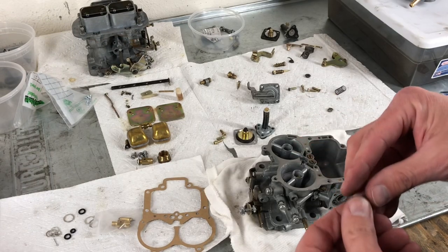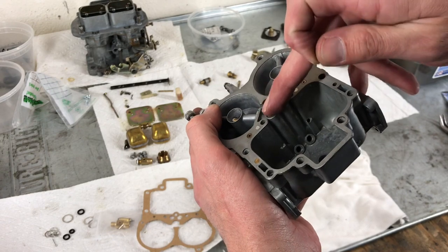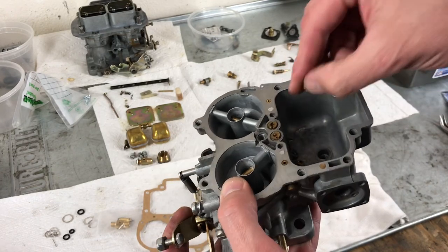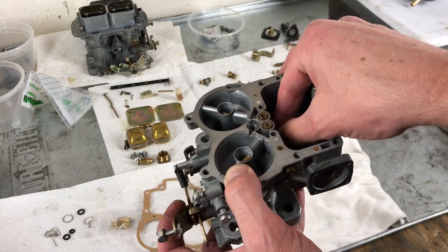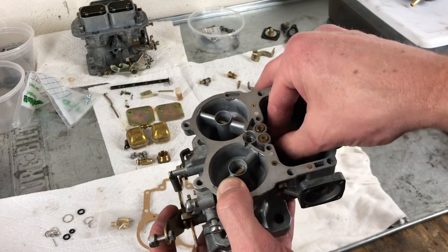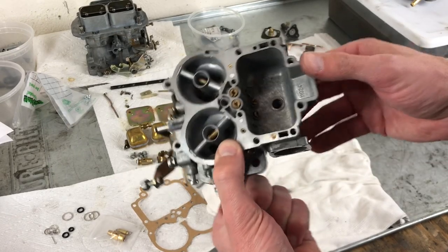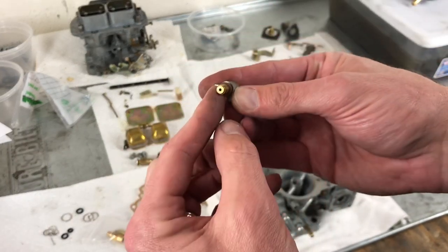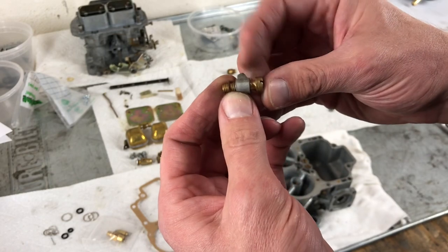Now that the air jets are in place, we're going to move on to the main jets, which are going to be down in the fuel bowl. The left side is going to be the 145, and the secondary will receive the 135. Your jet sizes might be different if you're building for a different vehicle or engine — these are what are running on the 240Z. With the main jets in place, we're going to place the accelerator pump jet and the delivery valve. Just a reminder: these have two copper washers — copper washer, then this piece, then another copper washer.